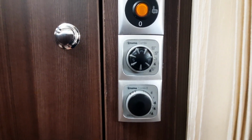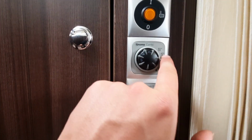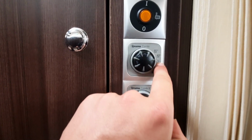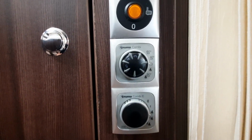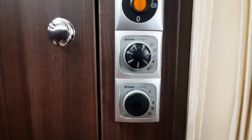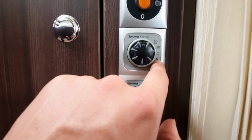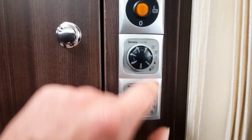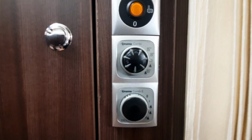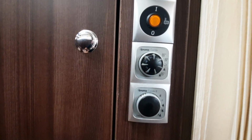If you've just got gas, you'll notice if you want to heat your water, you've got the option between 40 or 60. Flick it to 40 if you're having a shower, and flick it to 60 if you're washing your pots and pans. In the middle position here, as indicated by the O, stands for off. And then below that, you've got a little gas symbol and a gas and 60 symbol. That'll allow you to, instead of heating the water, this little flame will allow you to heat just the vehicle itself. Or if you want to heat both the vehicle and water off just the gas, so if you're wild camping, you can flick that all the way down to the bottom. You've then got a dial here, which will allow you to change the intensity of that.